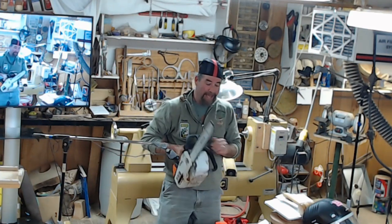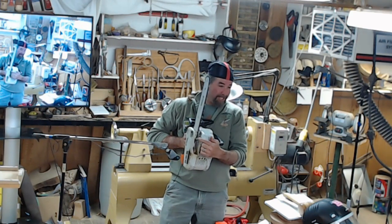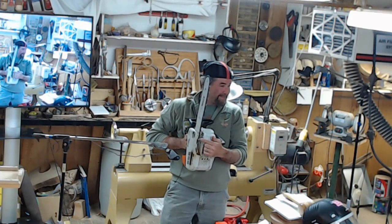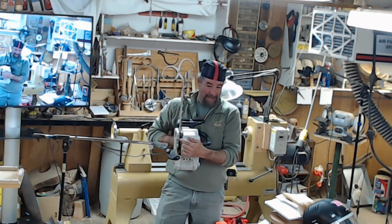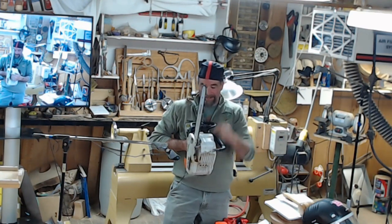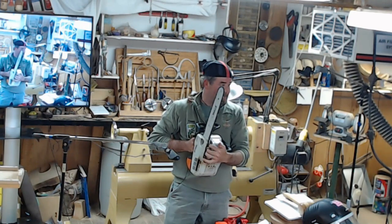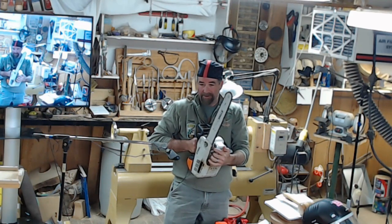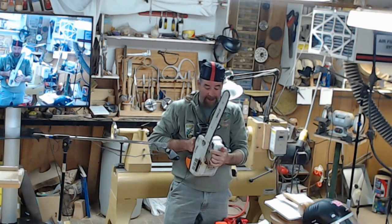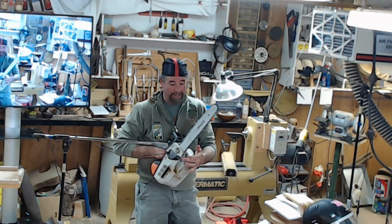Another thing that helps you with that is this little piece of aluminum down here. It's called a chain grabber. This isn't just a waste of space or extra money. It actually will save your life. If the chain does come off the bar, it grabs this and usually thrashes them, breaks them, cuts them, but it doesn't destroy the chain and the chain doesn't hit you. For $5, it's worth every penny. So keep an eye on those, replace those when needed.